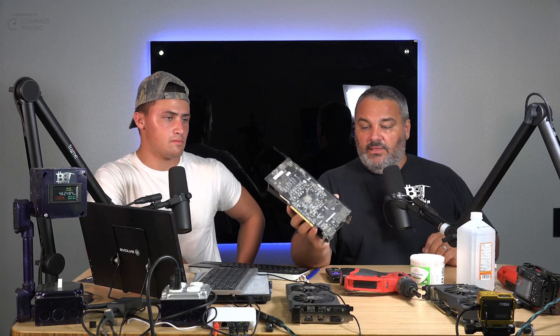We've already done one, so I have some basic confidence. There was an issue with the thermal paste — there it is, it's crusty, all the viscosity is gone, it's literally just dust essentially. That's why these GPUs were getting up to close to 85°C. The design on these ASUS Strix 570s isn't great either — the heatsink only covers about three of the memory chips out of seven, which is a terrible design. We did put an extra thermal pad on that though.